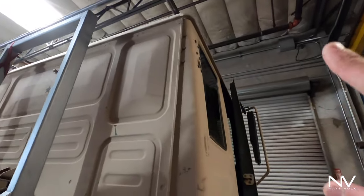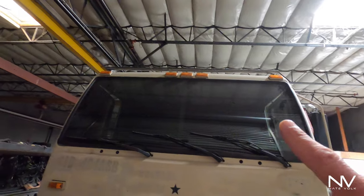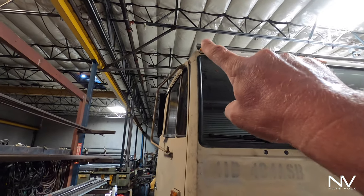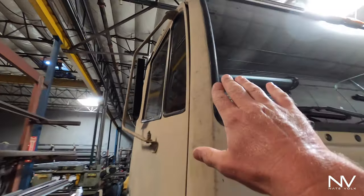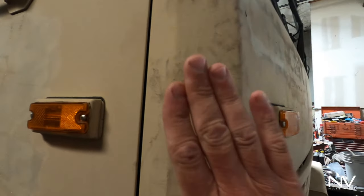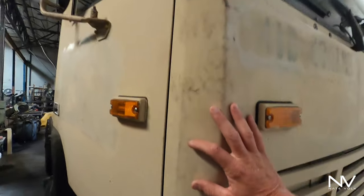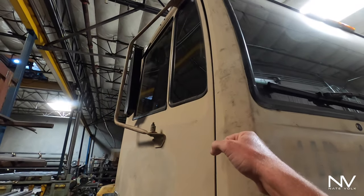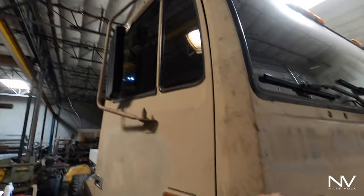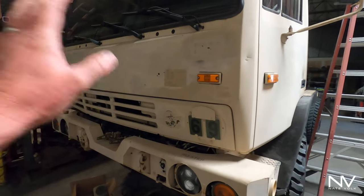The other thing we did yesterday and today was I started on the roof rack — can't really see it too well from down here but I'll climb up and show you in a moment. I have a crossbar on the upper section, and on this corner I'm going to have an elbow with a bar that comes down following this curved line, comes in nice and close, then mounts in here with an elbow return to a plate. That keeps it nice and strong and sturdy, and it'll be replaceable — if I hit something and bend it, it'll protect the windshield and side windows. I can just unbolt it, slide that bar out, make another one, slide it in, and bolt it back. I'm also going to do a crossbar up here for some light tabs and to protect the windshield.